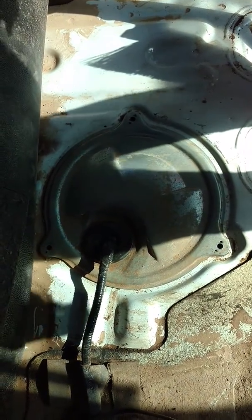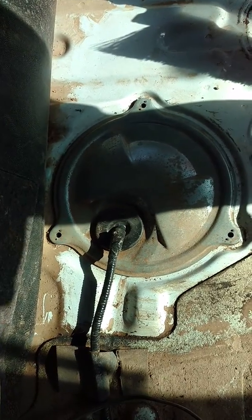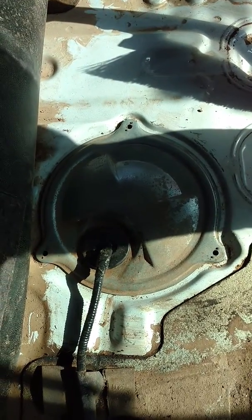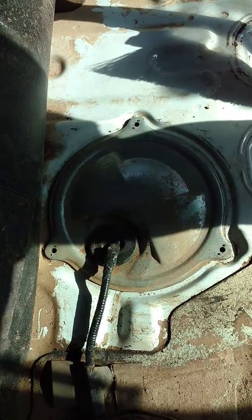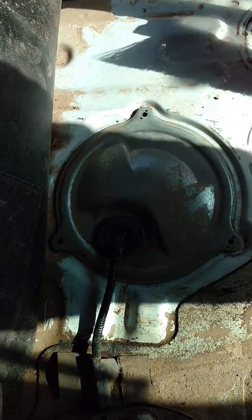So if you're wondering on a 2002 to 2006 Honda CR-V where your fuel pump is, it's underneath the carpeting under the back seat. You have to pull the seats to the back position, pull down the backs of the seats, then pull on this little strap here and they'll flip forward. Lift up the carpeting and there's your fuel pump.